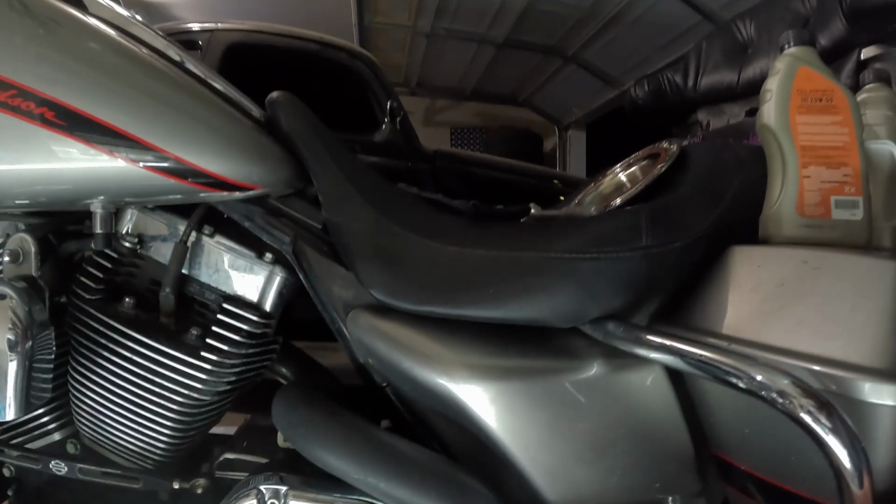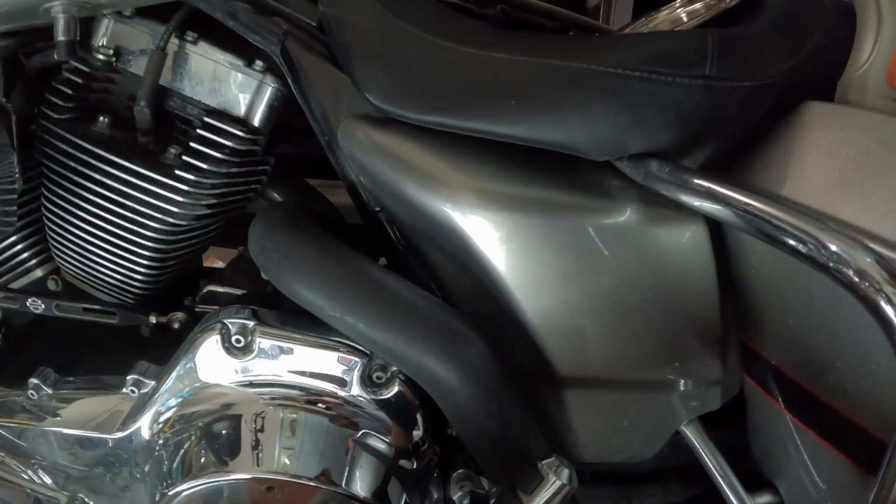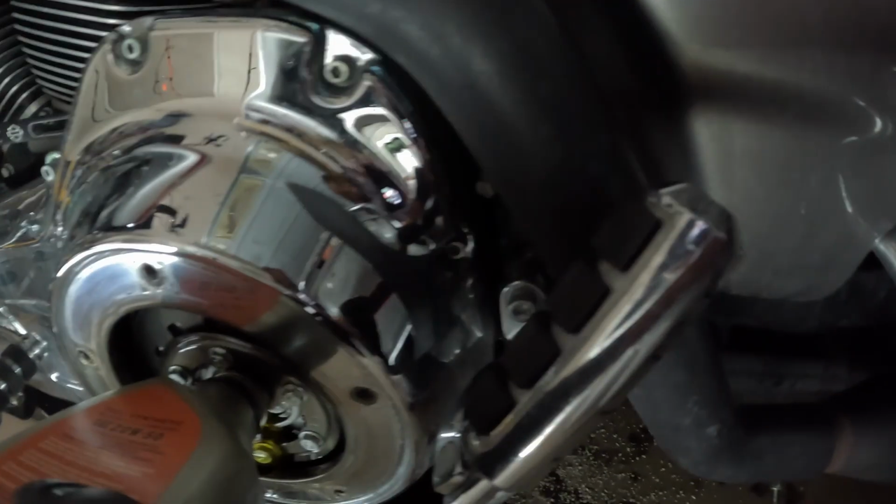I was thinking that I remember putting 3.5 quarts in my motor last time. So I got on the computer, searched for a 2008 service manual PDF, and I was right. I was thinking 2.5, but I was wrong. So I just added another quart in the motor, and then I'm gonna fill up the primary. This guy says if you put your oil like this, and you can pour it right in there, it works perfect.